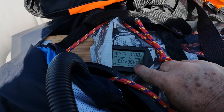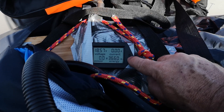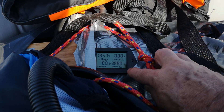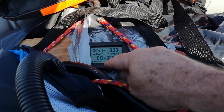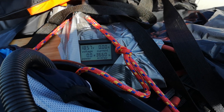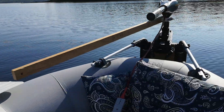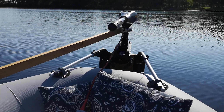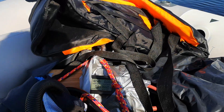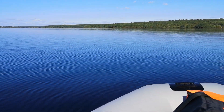Get yourself one of these watt meters. Ignore that reading — I didn't reset it today, so that 3.66 kilowatt-hours is from before. There's a button to reset it but I can't figure it out. When you're running, you can watch the wattage, how many watts you're pulling, how many volts your battery is — I'm still at 18.5 volts, started close to 20 — and also your amp draw. This 12-volt trolling motor will run at about 40 amps at 12 volts, giving you about 480 watts. Today I never went over about 20-something amps, staying under 30 for sure, running around 12 or 13 amps when I was at 250 watts.